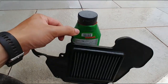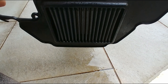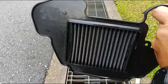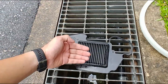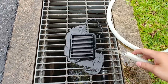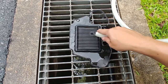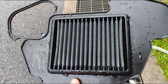It's almost 10 minutes, so we knock off the chemical before we start draining. It's not as dirty as I imagined. Now we bring it to rinse. Remember the orientation — the outer part is the side with the brand, and the inner part is without. Because you want the dirty water to flow out, you put the outer part at the bottom, then rinse from the top. Just use normal water — no high-pressure jet, as that would damage the foam inside. You should see it come out light grey.